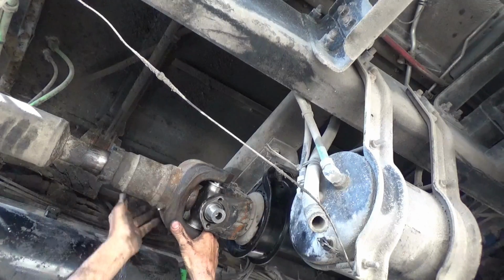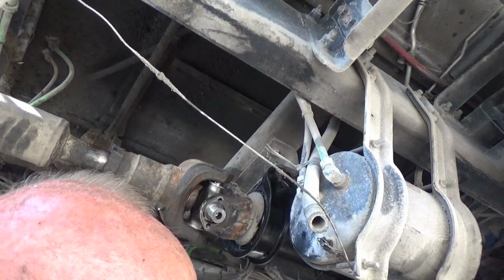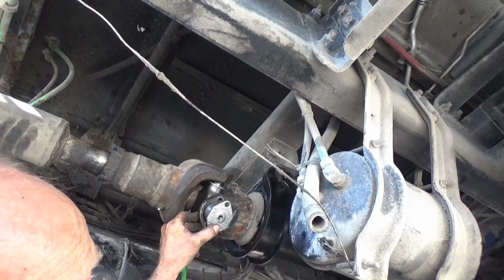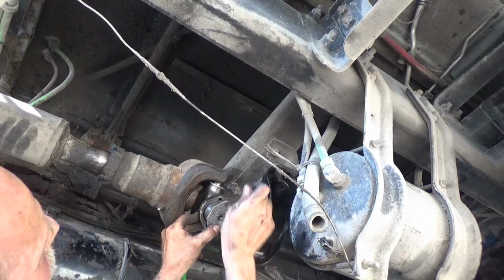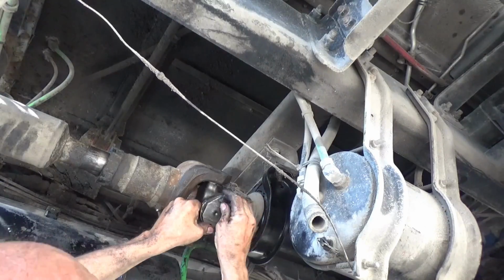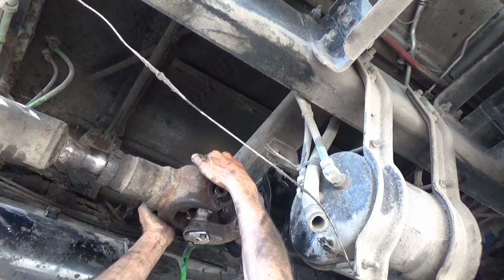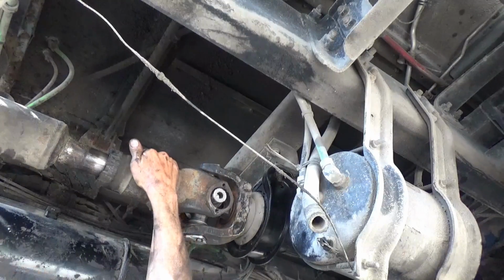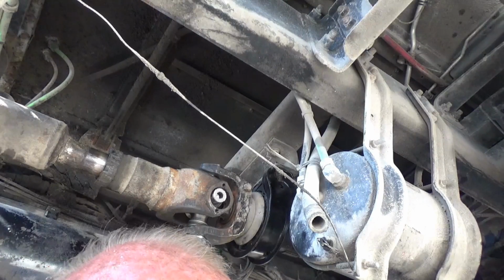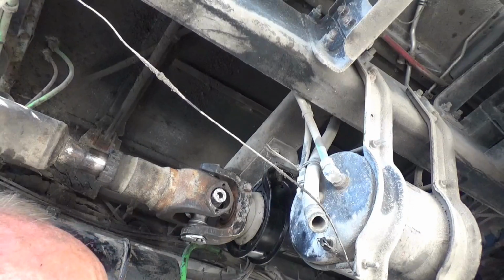There. Now that we got them all in position, go ahead and start putting these caps on with whichever one is easiest to get to first. And by the way, leave your drive line in a position where you can turn it by hand. Wheels are off the ground, transmission's in neutral.